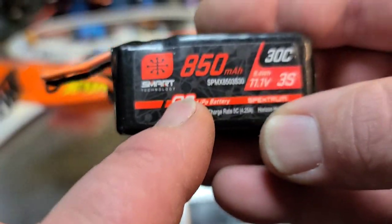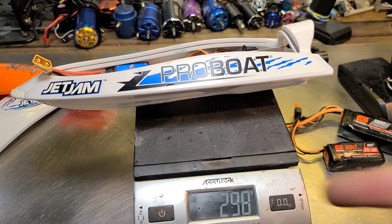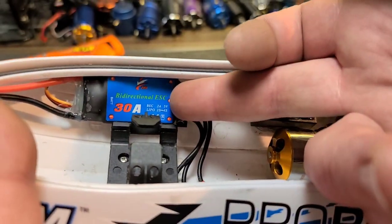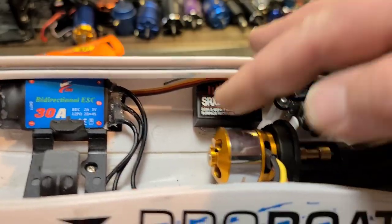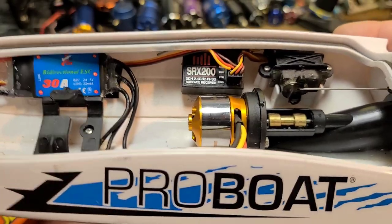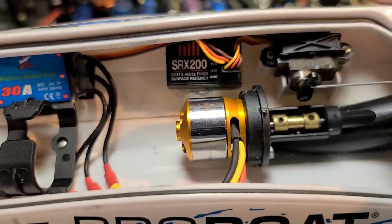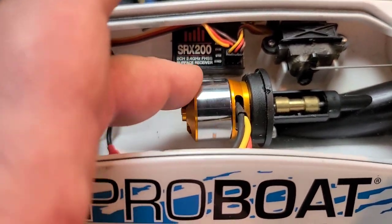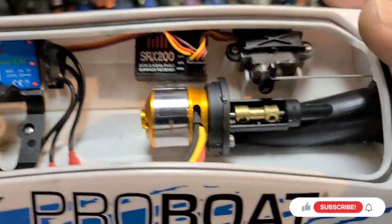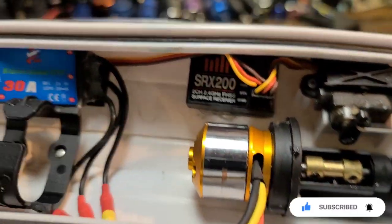If we throw the lightweight 850 G2 3S battery in, at 372 grams it's going to be lighter than the stock setup at 430 grams. We may try both batteries. Hopefully this helps you guys out — it's a cheap upgrade. The ESC is $10, the 2835 motor runs $15 to $40, receiver maybe $30 if you don't have one, so all said and done about $65 to $70. They also sell a green T-Rex helicopter motor — I think it's around 3200 kV — which would work in the boat too, though you'd have to worry about the impeller. We're going to test it in the next video. See you guys next time!